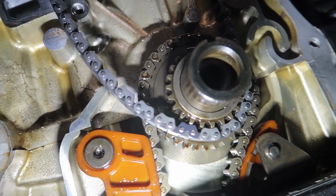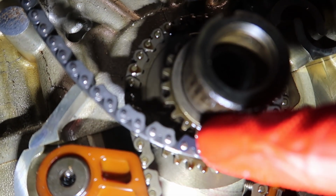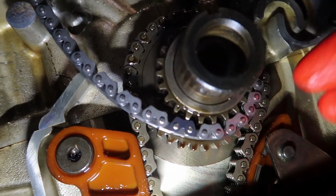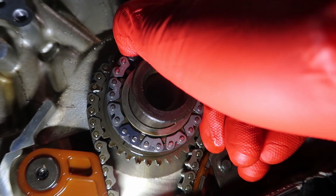Now that the top is good, we're gonna install the lower part. Remember that dot I was talking about right here? It's like a little dimple. You wanna make sure this blue part lines up with that. I did tell you guys that the crank did spin a little bit, but we're gonna see. Yeah, it's good. So we can install everything now.